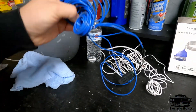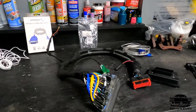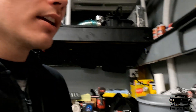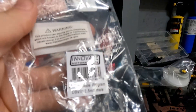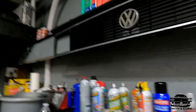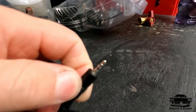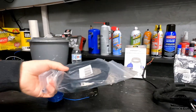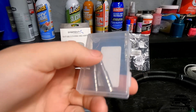You could also send the launch control wire to a clutch switch or your e-brake switch — there are many options. This is a ground-side wire, meaning how you activate it is by putting it to ground. You need a USB-to-serial data cable — I got a 10-foot one so it goes inside the car and is nice and easy. I actually melted my cable the other day — I left it in the engine bay and it melted. This is the replacement cable; the part number is an Innovate LC1 controller number.